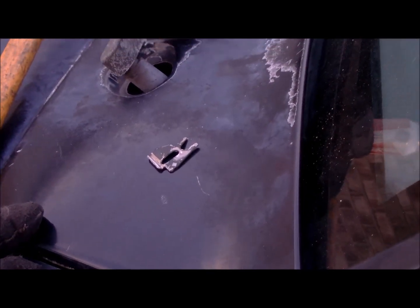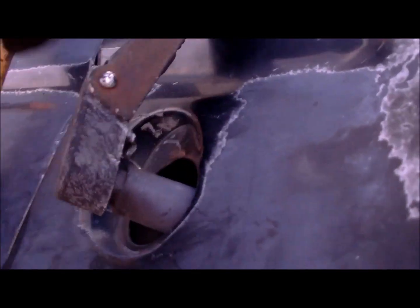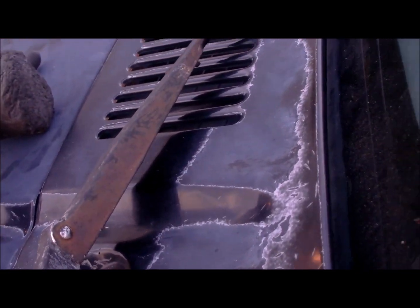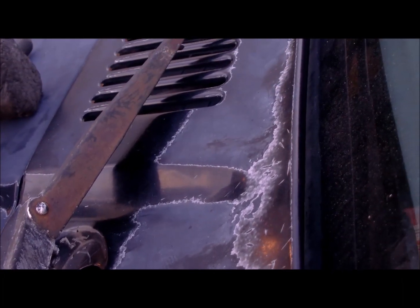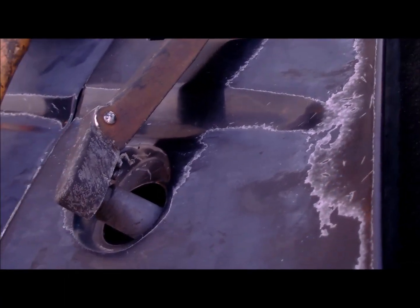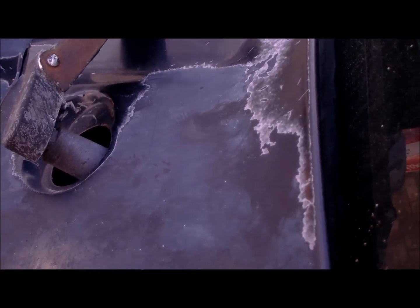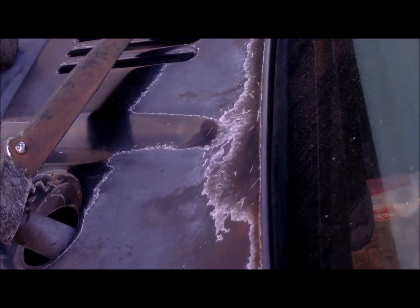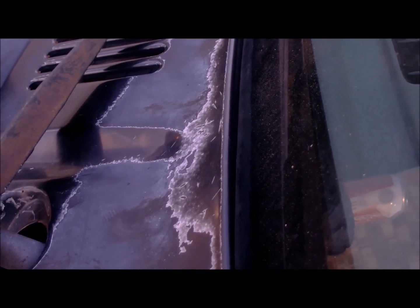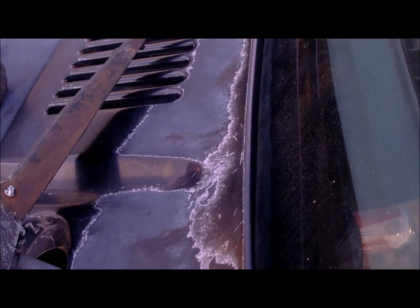Do this at your own risk. I cannot get these pieces back in — they're hammered on and not going anywhere. I don't know if I really even need those in there, so I'm not putting them back on, but it works fine and the washers are working good. I don't even know how to get them back in there. That's how you change the bushings on the wiper linkage on a 1995 Dodge Dakota. Yeah, look at that baby — there you go!